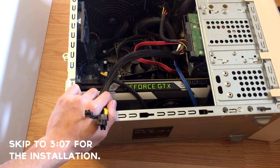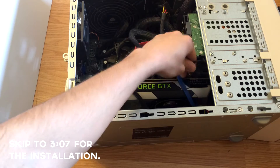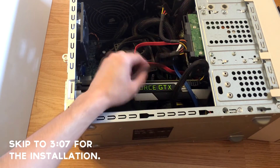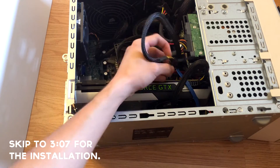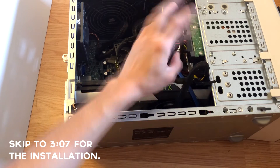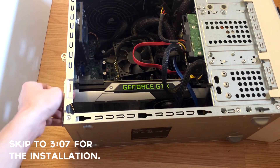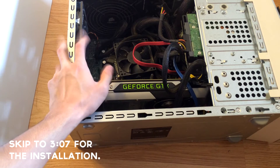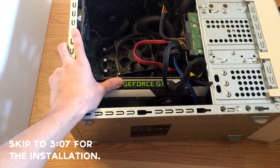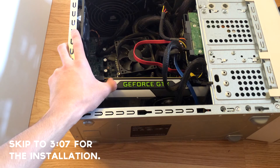The graphics card, if it requires a lot of power, it's best to plug these PCI Express power connectors in now. Got that side in — now it's hard to do because the case is really small. And there's a second one. So unfortunately my case doesn't have very great air ventilation. I do plan on upgrading my chassis sometime later, but for now I wouldn't really overclock the card since my power supply isn't that much anyways.